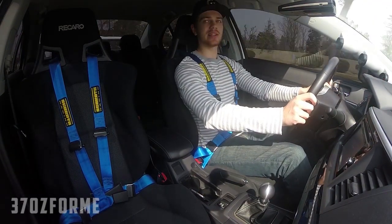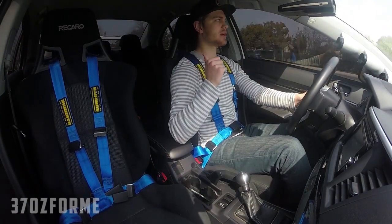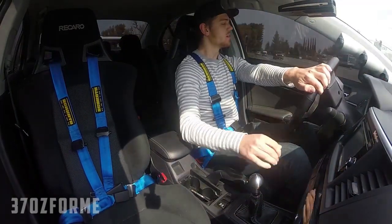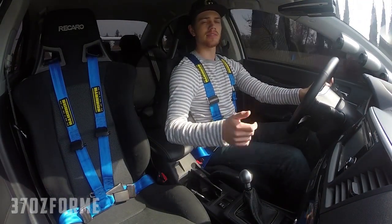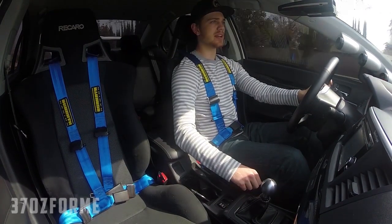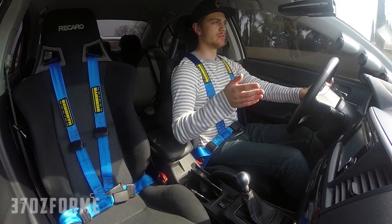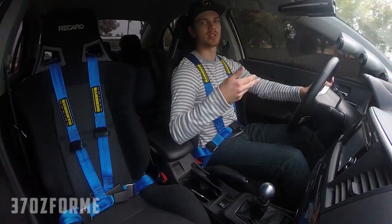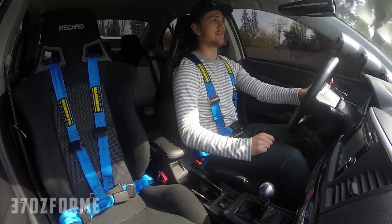The brakes, as you may or may not know, I upgraded to the StopTech BBK 6-piston brake kit with 4 pistons in the rear when I did the turbo upgrade, and I haven't seen any real brake wear or fade. I have braked pretty hard in the car, and I've taken some canyons relatively aggressively, and I really haven't seen any issues with the brakes. The only reason I brought it up is as a power-related wear item: the more power, the more prone I am to going faster, which requires more stopping power. Like I said, there are no other issues that I've noticed that have worn out.